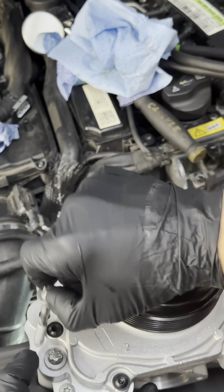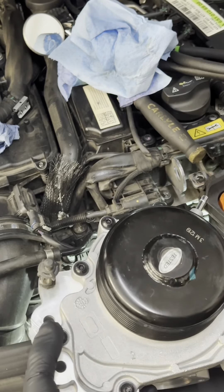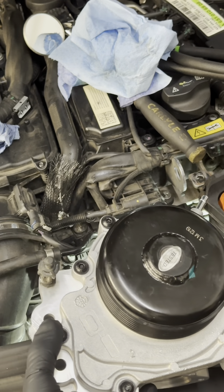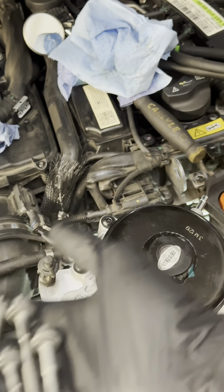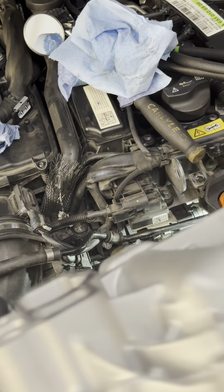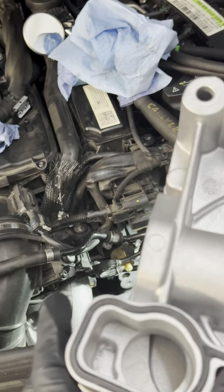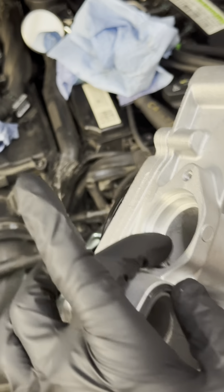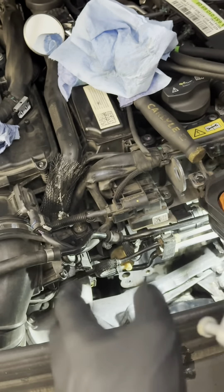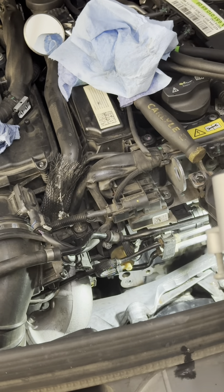The new one is right here. The bolts were set — all four of the bolts that hold down the water pump are the same, so there's no mixing up on that. All I have to do now is install it. There's already a new gasket and this O-ring installed on this side of the hose, and now we just install it the same way we took it off.